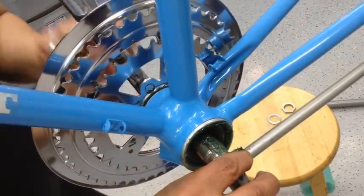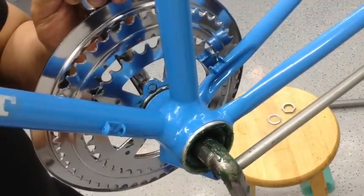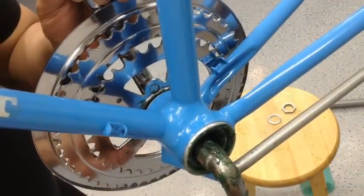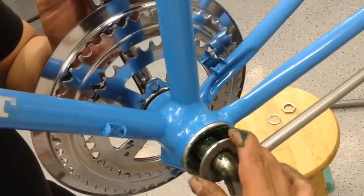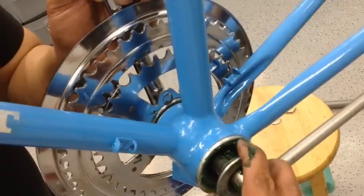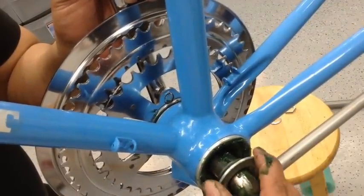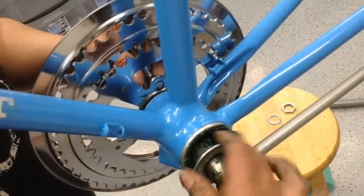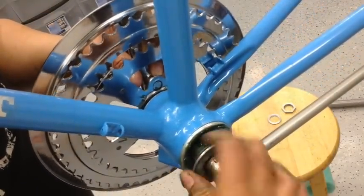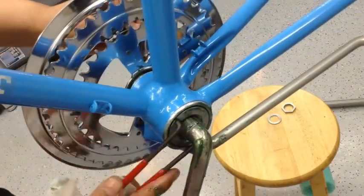And then I'm going to grab the cone and use the same grease that I already have in my hands. Again, I already put plenty in there, so not much more else needed. And this goes counterclockwise, so make sure you don't cross-thread it. So once you get it started, just turn it a little bit. And then use the spanner tool here